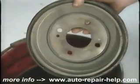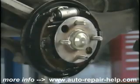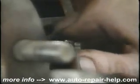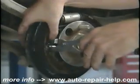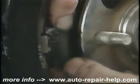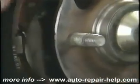Now that we've got everything washed, we want to grease the backing plate. In order to do so, we need to remove the brake hold-down spring. Some are spring clips like this. Still others are a spiral spring with a cap on it. Take off both the front and the rear shoe hold-down springs. This will allow us to pull the shoe away from the backing plate just a little bit.